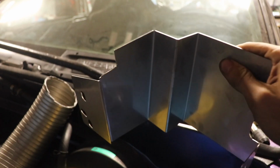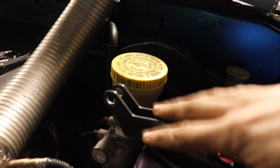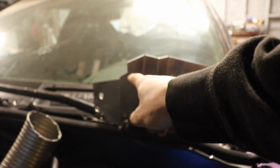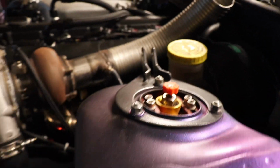So on a heat shield, I had to notch that little corner out because it runs into where our strut brace goes, and rather than modifying the strut brace, we can just notch the corner. So that's what I did. Got the Bondo out of the holes. I had to retap the hole on the bottom because it had a bunch of Bondo in the threads. The bottom was good and the top one is just a regular hole, so it's going to have a nut and bolt.